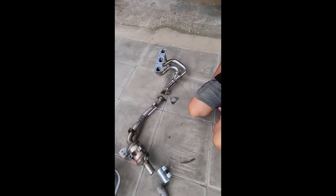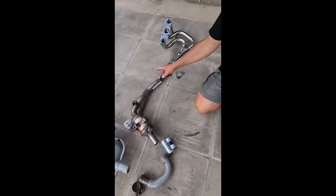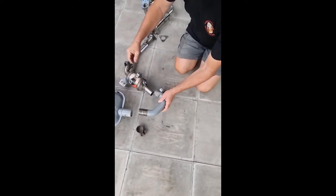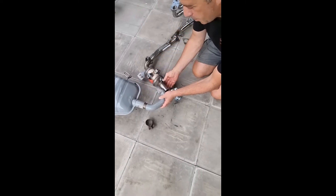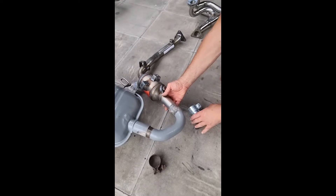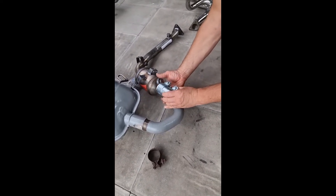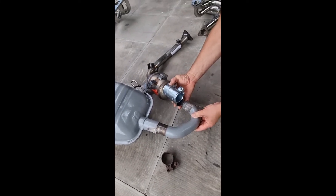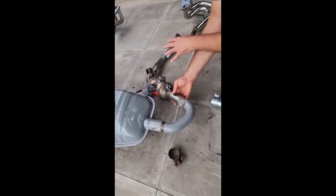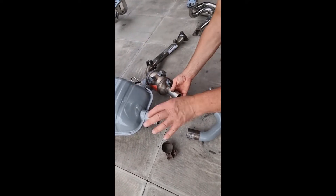Moving across the cat, we've got blanking screws in here for the oxygen sensors — when we swap the exhaust over, we'll put new sensors in on this particular system. The joint on this end is just butted up against the cat and held with a sleeve. To take this apart, we need to get the sleeve off, slide it at one end, and allow the pipe to pull apart. If the two pipes were sleeved into each other, we wouldn't be able to take the silencer off without taking the cats off. So it's designed so that with the sleeve, you can take the U-bend out and drop the silencer away from the car.